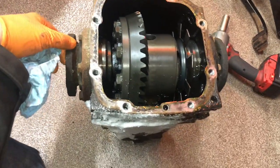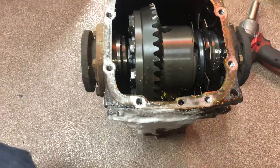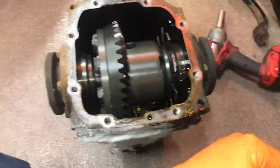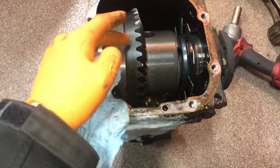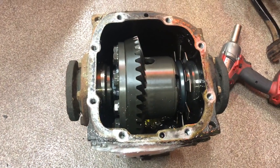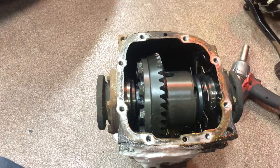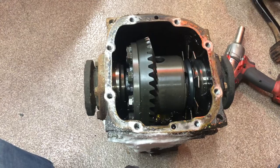Next up I'm actually going to drain it — not very exciting, but I'm just going to tip it into a bucket and drain it out for quite a few minutes. Then I'll come back and yank the output flanges out, which I basically just do with a pry bar and a hammer. Then we'll take the sealing carriers out, the entire center section will come out, and I'll show you how to remove the pinion gear as well as some bearings.